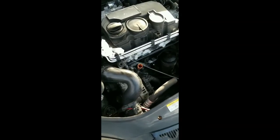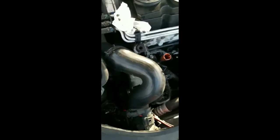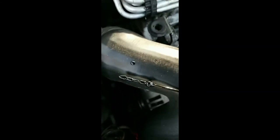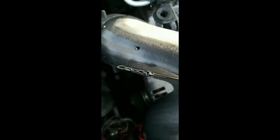Last step: check the oil level. Pull your dipstick out, wipe it off, get all that last little bit of oil off. Stick it back down in, pull it out, and check where the shiny part is — it should line up right in the middle. So I'm good.